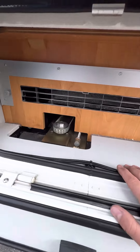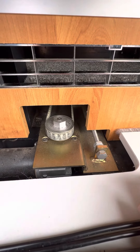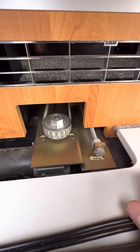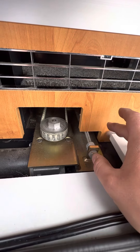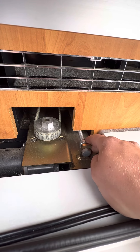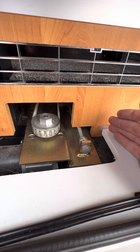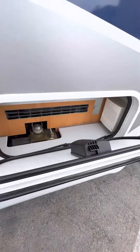You've got your locker at the front here which is quite important. This is your sort of manual override for the raising floor in the cab. So if you had any problems and you desperately needed to get it down or up, you can manually do it from here. We have had to do it before - it's a little bit awkward, which is why we've made sure it's definitely working exactly how it should, so you shouldn't ever have to do that.